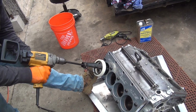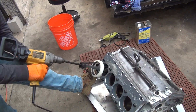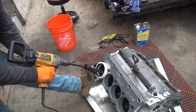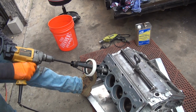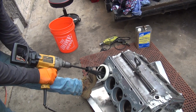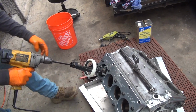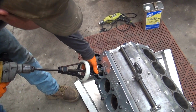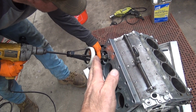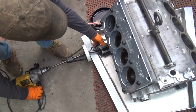Faster stroking. Don't stop at the top like you're doing. See, as you stop at the top, it makes the crosshatch go away. You're coming up real slow and staying there too long before going down. So it gives you a mismatched crosshatch.